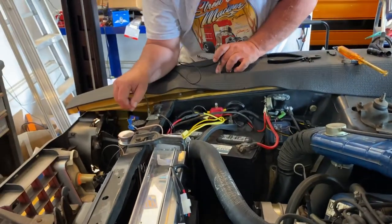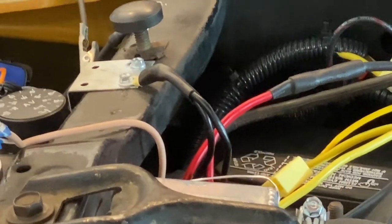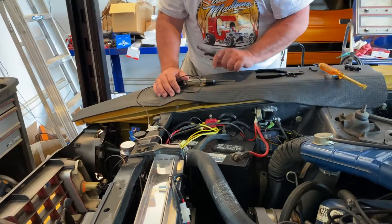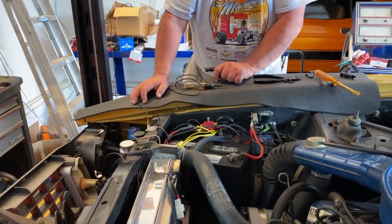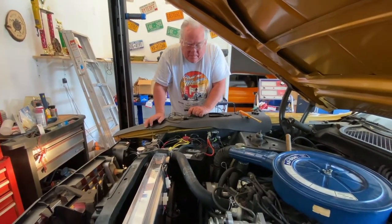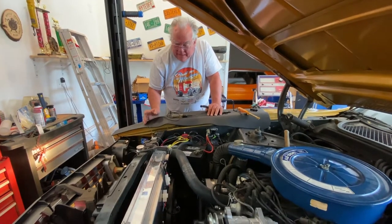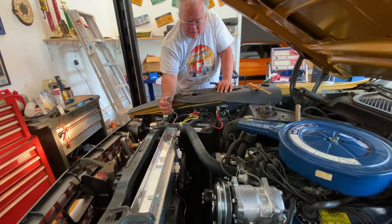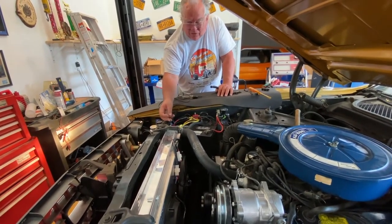I'm going to go ahead and go off camera. I'll put these wiring conduits back in place to make this nice and neat, take this apart, and re-terminate that ground. I'm betting that after that the fans will start working properly. I'll also reconnect with another splice lock the ground for the front camera — I bet that starts working too.